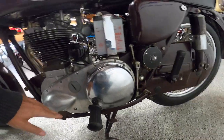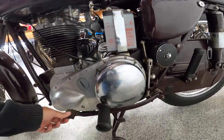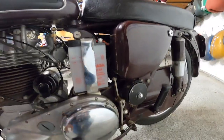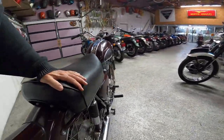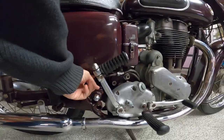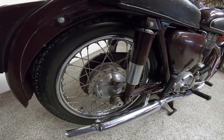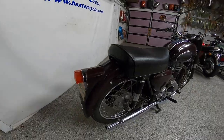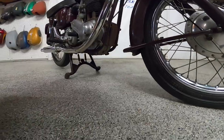Here's the brake system, and here's an interesting thing. The brake fulcrums here — this is about a 14 to 16 inch long lever that goes up here and jogs over here. Watch that as it moves. It goes over here where it actuates a cable, and this cable runs back here to the drum brake on the back. A lot of complexity it would seem — there's a lot of effort that went into getting that right.